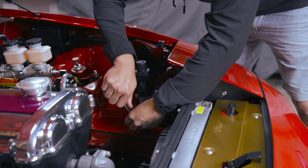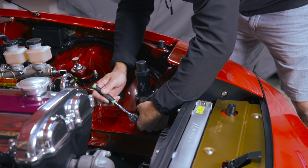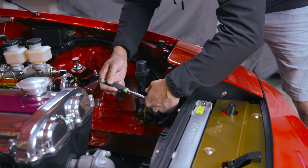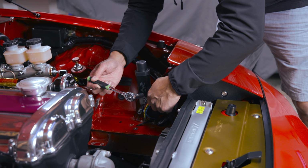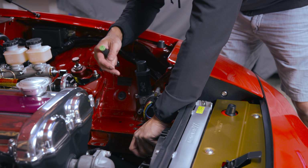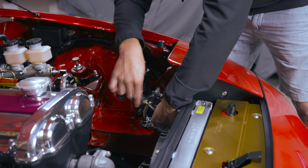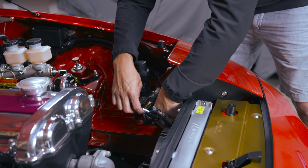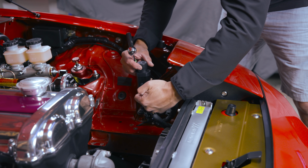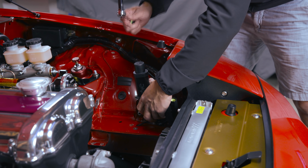10 mil, 1.5. Pop this off. Okay, and then you obviously have to disconnect the pigtail, which is already loose. If you have an airbox here, like the Flying Miata turbo airbox, you're going to need to remove it. And I've already done that because I'm working on my turbo. And yeah, it's open. Okay, take off 3 bolts, put them in your pocket because they'll run away.